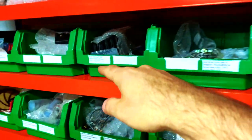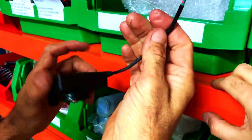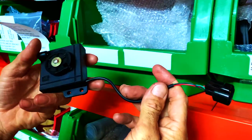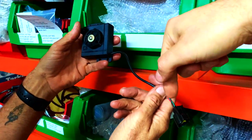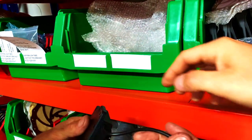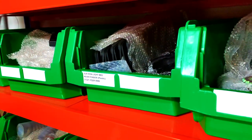So, what about throttle? Throttle box, yeah. So the whole box for the original X version bikes. Now they're actually changing this, direct electronic from the grip. This one used to be front handlebar, cable pull, all the way to this box, from this box to the motor controller, right? Yeah, this box was mechanically actuated. And some people complain they got mud inside and something happened. So they're going full electric now, straight from the grip. Full electric, not mechanical parts, man.